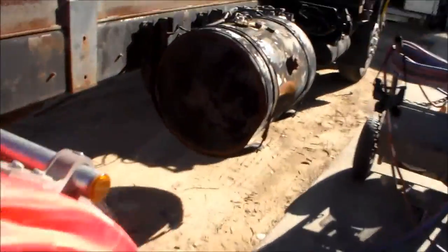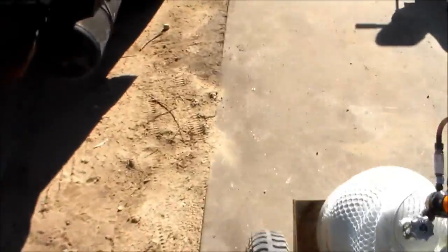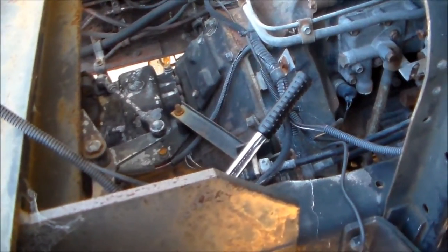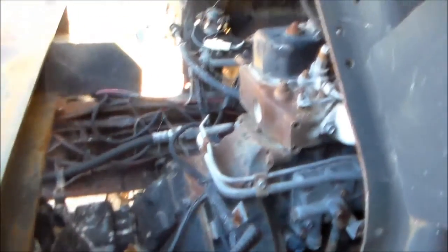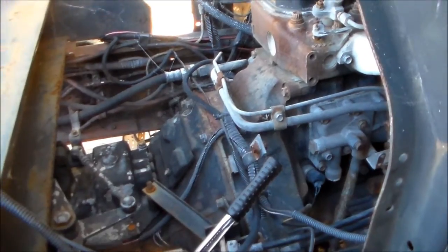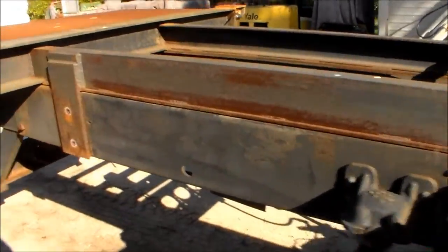Anyway, rear main seal needs to be done. Needs to pass the pits. I already did the job once about a year ago, and for some reason after about 5 hours of running it spat the seal, even though I did it as good as I bloody think I could. I don't think there's any other way than a correct way to put a seal in, and the fact it lasted 5 hours and then went tells me something else happened. So we're pulling it apart again to investigate. Dad seems to believe that the flywheel is out of balance. If that was the case, then it might be putting a bit of vibration on the crank, which would put vibration on the seal, which would stuff it.